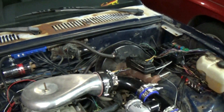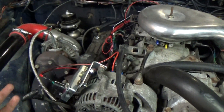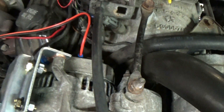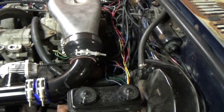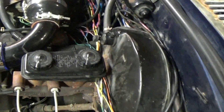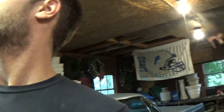I'm going to run the fuel pump signal off of the one that's inside, and then I'll have the relay probably underneath the truck right next to the fuel pump. This is the one that was on the Eclipse and it did function fine - two wires run off of it, power and it grounds off the alternator. Got the coolant and air temp sensors hooked up. I left a ton of extra wire because too much is better than not enough. Got the intercooler piping put back together. The battery should be charged, which means it's time to see if it'll start.